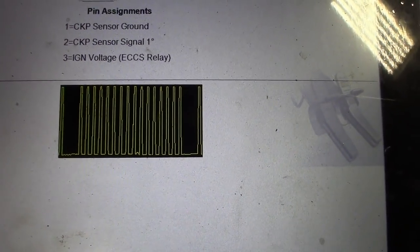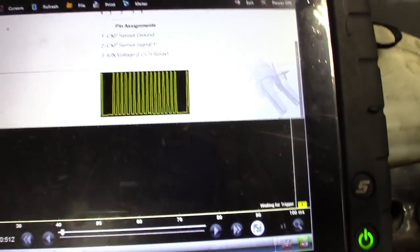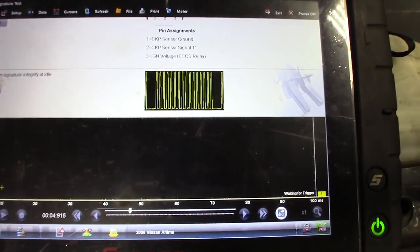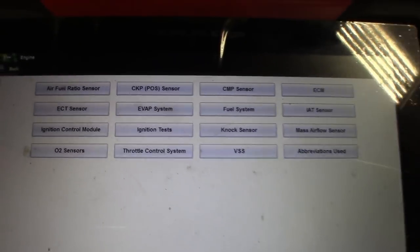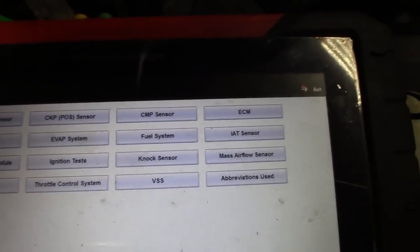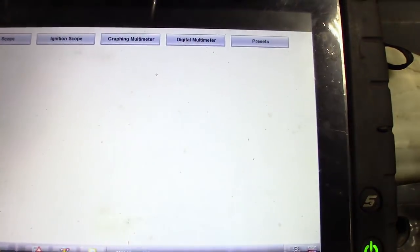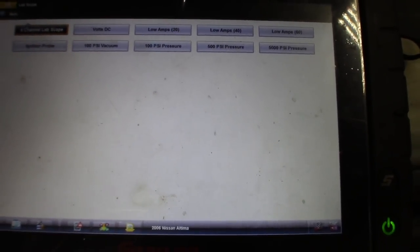The crank is a times-16 pattern, so that's a full revolution right there. You can view meter and compare it — just a quick tip. I'll sometimes reference this; they're not all in here but there is a good amount. If you know where the pins are in the ECU, you can always pin it and get a good signature. But let's go back, go to scope meter, and we'll set up our time and voltage and all that stuff. Four-channel lab scope — there's all our scopes, we're only using two, so we'll turn the other two off.